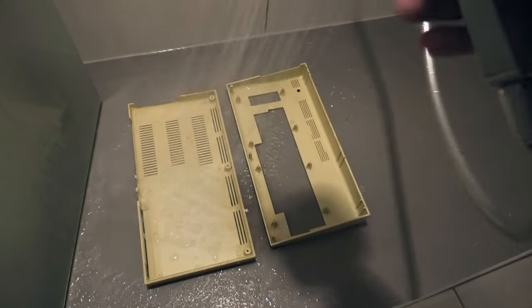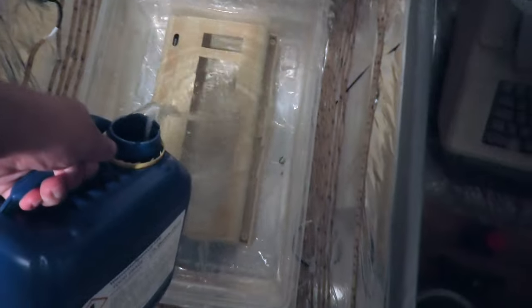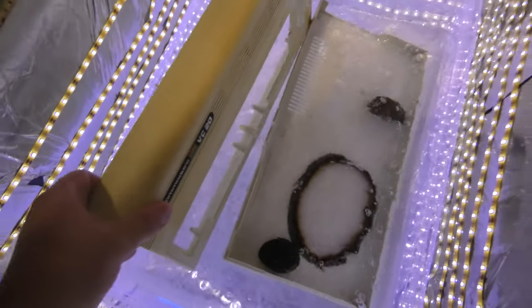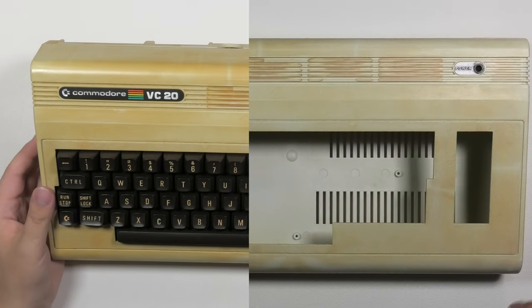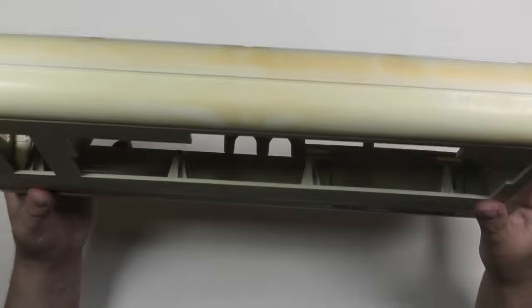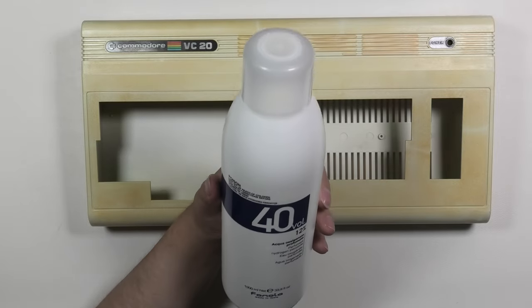I rinsed the parts in the shower, which removed most of the crud. Then I filled up a bucket with hot water, submerged the plastic parts, and added liquid 12% hydrogen peroxide. After about a day and a half I removed them from the UV light, since not a lot was happening. Comparing the top cover, there is a slight improvement — maybe 5%. On the side the results seem a little bit better. On the front the white spots are still apparent. I want to take a different approach — the cream and cling film method, which seems to give quite nice results with UV light. But that will have to wait.